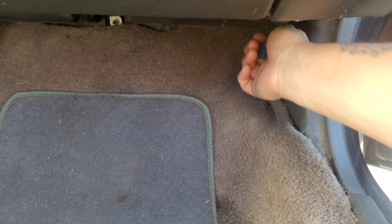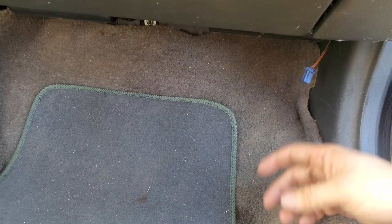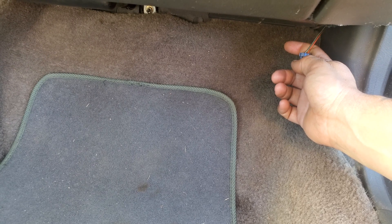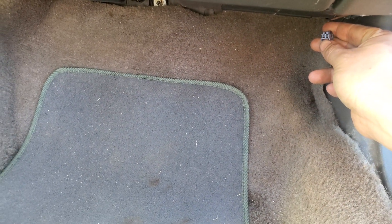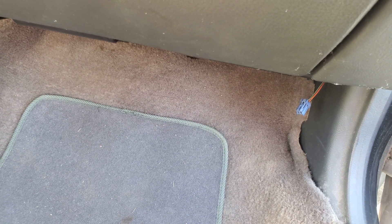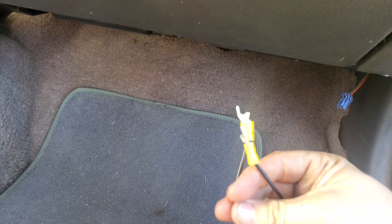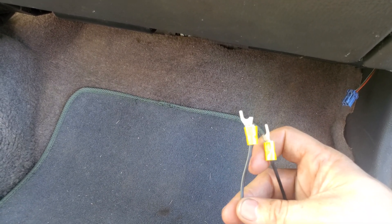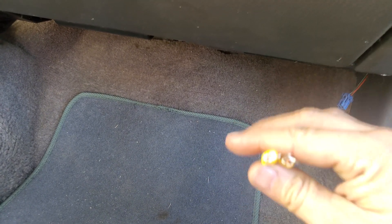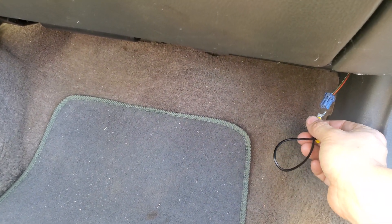To check this, I'm on the passenger side next to the kick panel right here. There's this blue connector — this one has a green and orange or red wire, and the green connector looks like it has a white stripe, but it should just be a two-pin connector. All you need is a jumper wire or a paper clip. I just use a piece of wire with two split terminal connectors — I just clip one end off. Same one I've been using for years on these OBD1s.